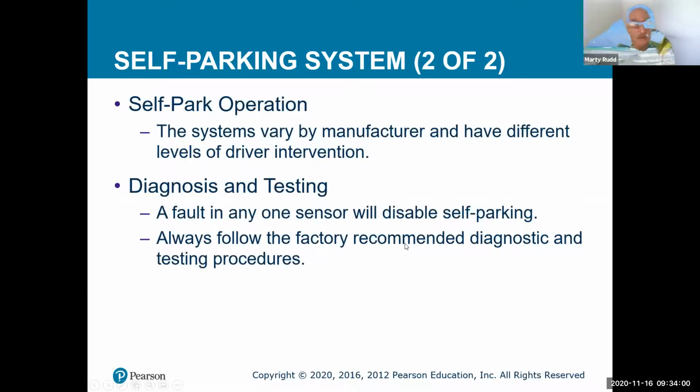So this is some of the features of electric steering. Remember that it's electric steering, instead of having a hydraulic or a manual type steering, it's using an electric motor that gives assist, kind of like a hydraulic, but it uses electric motors to do this. And they're going to use sensors to see what road speed is going on. It's also going to see what demand is going on, and if it's straight ahead or not, to calculate how much assist it's going to give you.